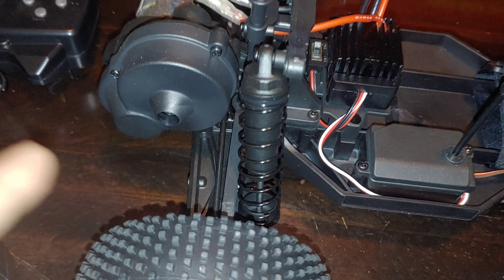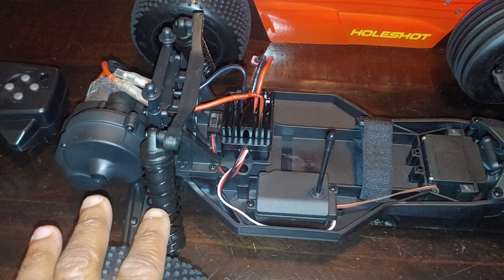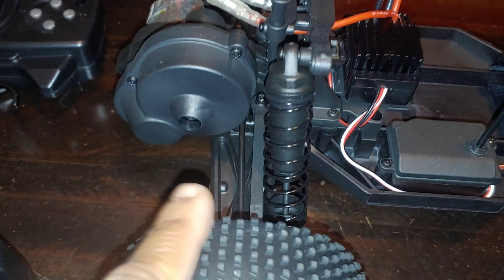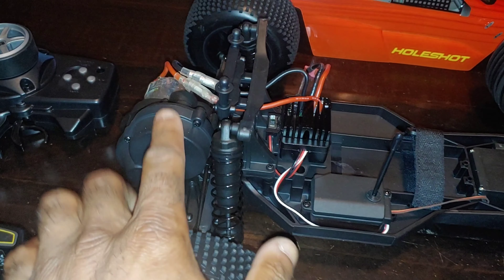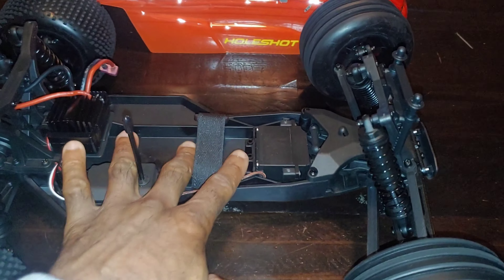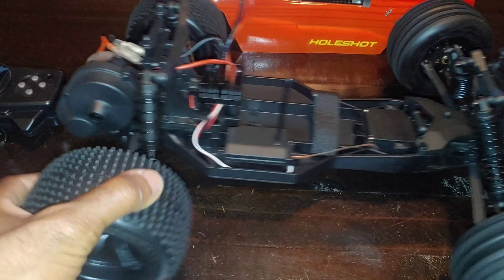It's very difficult to get a vehicle — especially a two-wheel drive stadium truck under $200 — that has features like that. Most stadium trucks, just about every one I know of, come with plastic back there, so you either have to upgrade or it's going to break. ECX has theirs but those have to be upgraded when you add more power, same with the Traxxas Rustler, etc. — they all come with plastic. This one actually comes with dog bones. The gear ratio may be a little limited — I'm not sure what it is — but the setup is going to be pretty decent out of the box. It does come with Dean's connectors.